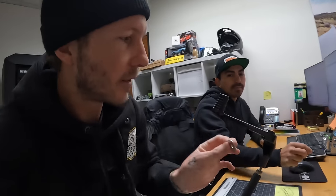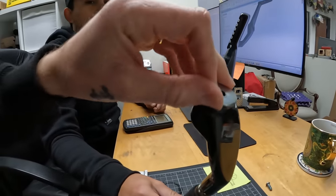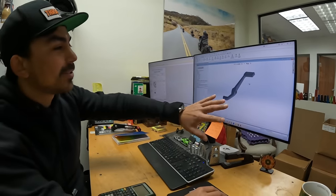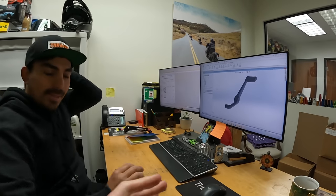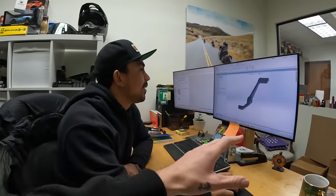The big part of that is how we can design and develop a better brake arm. You can see some of the flaws — this is the washer that sits on the outside of the brake arm and you can see it's scraped and bent. That is the first point of contact when you lean the soft tail over too far; it hits on your brake arm right there. We took that into consideration while designing this. From the 3D scan, we were able to import the actual data into SOLIDWORKS — that's the stock one — and now we get full range of motion to see every detail of it. How many years of schooling and in the field have you been working with this program to be able to do this?